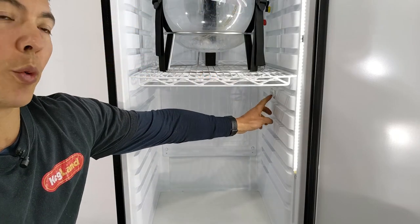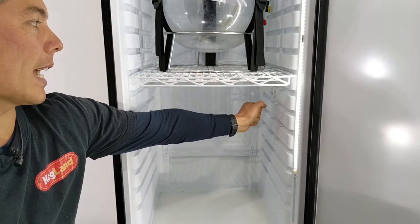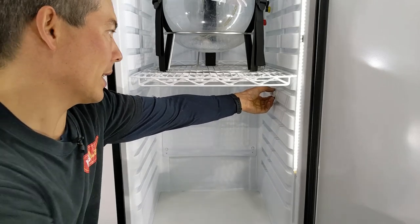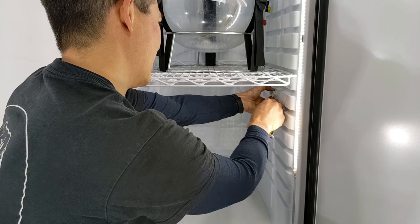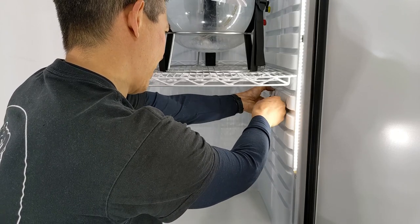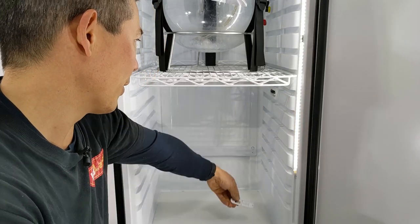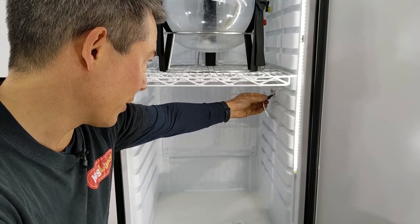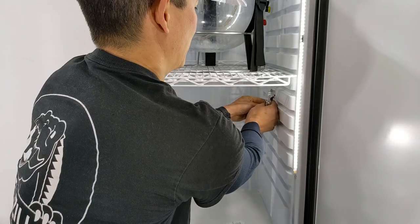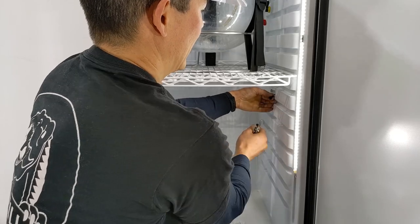On the right-hand side wall of the fridge here, you'll see this little plastic cage. The first thing you want to do is basically pry this off — just use a flat-head screwdriver, I'm just using the Leatherman — pry off the clip from the front and then the back will also follow out like so. Then get this cable, and you can see there's a little black clip here where you can unplug the temperature probe.